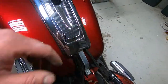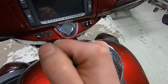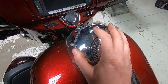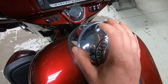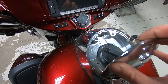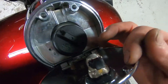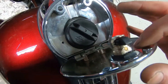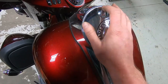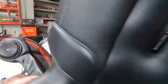You want to see that everything's looking good in here. I like to push on and bop the fuel cover on these newer motorcycles because almost half of the bikes I test ride, this is rattling. The rubber part isn't tall enough, so I have little foam pads I put in there to make it a tighter fit when you shut it so it doesn't rattle. Then let's take a look at the tour pack stuff.